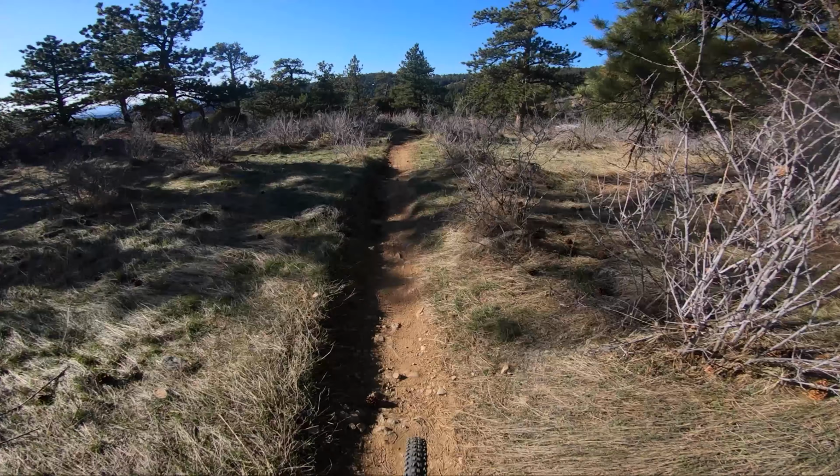Last week I had this bike as the Smash, if I'm saying that right. So the front triangle is the same one I had on the Smash. They switched the shock, the fork, and the seat stay. Now it's a Gnarvana. So it's a 20 millimeter bump in travel for the front. Took it from a 150 fork on the Smash to a 170 on the Gnarvana. 145 in the rear on the Smash, 160 in the rear on the Gnarvana.